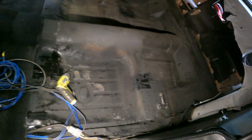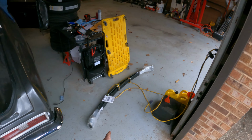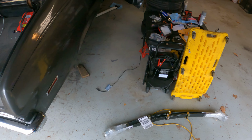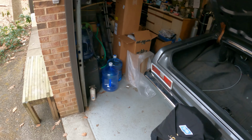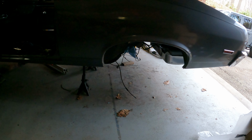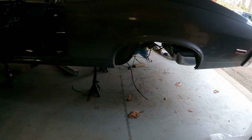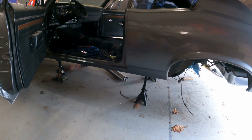But today we're going to be working on getting our suspension sorted out, and as I talked about in one of the previous videos, I did go ahead and get a set of Calvert split monoleafs that are lowered because I wanted to tuck that tire up. If you follow me on Instagram, Goat Rope Garage, I sent a picture of being able to get that 275 way up in the wheel well, and so I decided, hey, let's go ahead and tuck that thing down a little bit. I did cut the spring on the front another half coil.